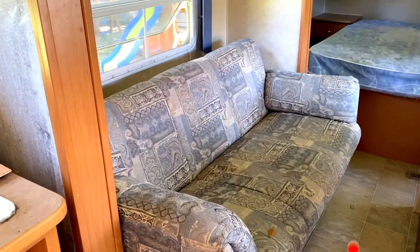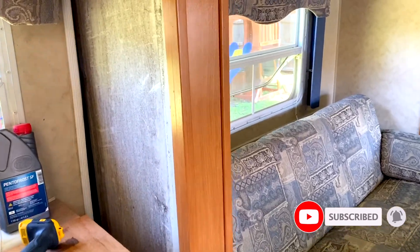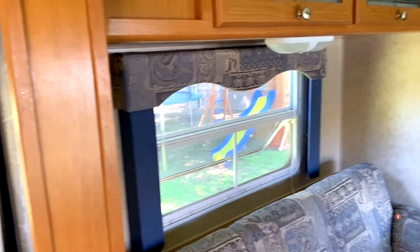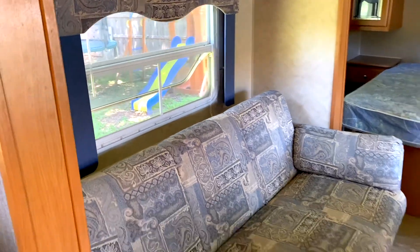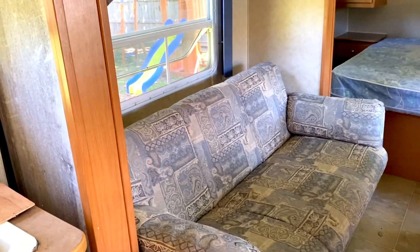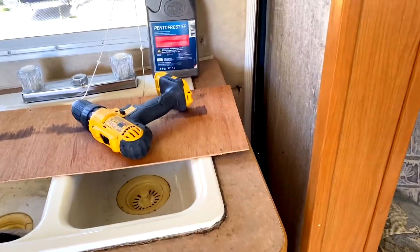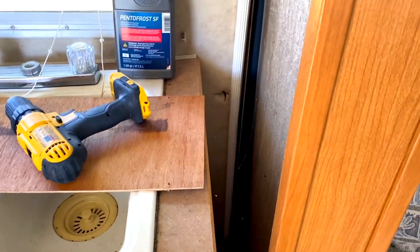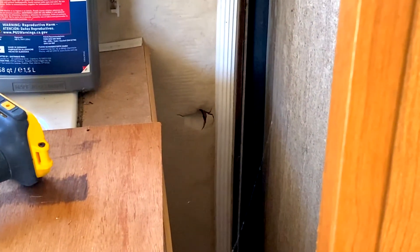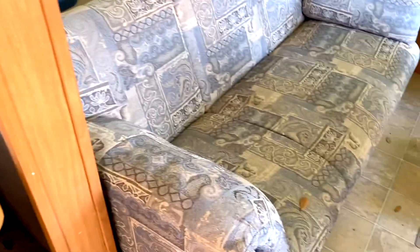One of the things we're going to have to do is rebuild this slide and fix some of the damage that's occurred due to water leaks. I'm going to have to remove the whole thing, pull it out of the camper, and start trying to assess what kind of water damage is in the walls and flooring. This wall here with the kitchen sink has a soft spot — it's just rotten. It appears there was a leak above the window on the outside, running down the wall and causing damage.